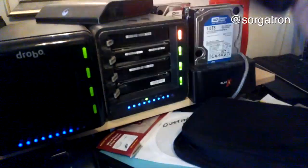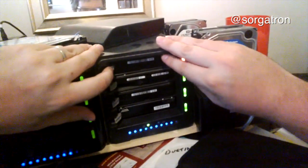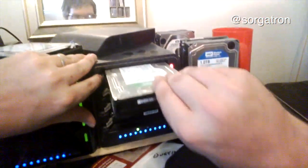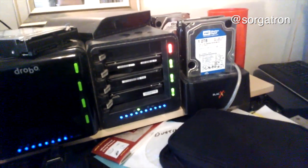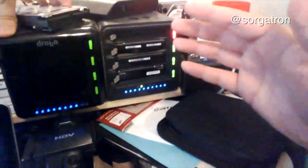I love these things — all I have to do is take the cover off and we can see our bare drives. They're a little dusty. We want to take that first drive out, so I'm setting our new drive aside for a second, pull the tab, and give it a second to react. We can see it's going to flash yellow — it knows something has changed. Then it goes red, meaning it's going to rearrange things, and we see the lights across the bottom fill all the way up.